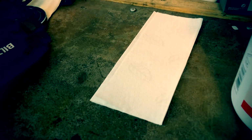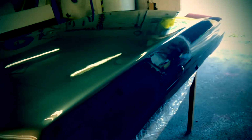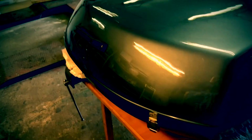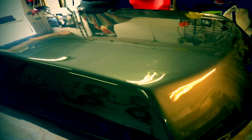And be sure to wipe everything off with a clean paper towel a bunch of times, until you see that the paper towels are actually white and don't leave any marks of dust and everything. And the CRC compound, which is inside, because if you leave too much compound on that area you're supposed to be repainting, the paint won't stick. But in general, just do that step by step as I told you, and it's gonna be fine because it degreases, as I said, and really does the trick for removing dust and everything in the pores of the paint.